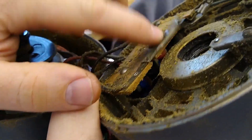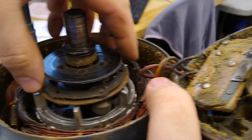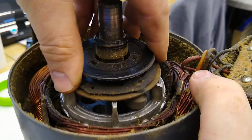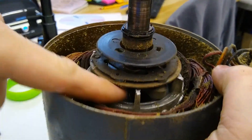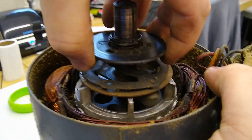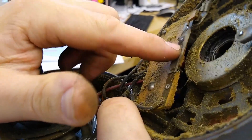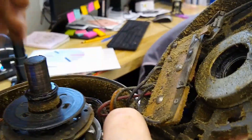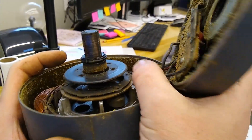So this motor does have a centrifugal switch here, so we're going to figure out exactly how this works. Right here, this is a centrifugal spring — it has these weights. You can't quite see them down here; we'll take them out in a little bit. But as this motor spins up faster, it shoves this piece right here further up, which presses this switch and should kick out a starting winding. But I thought these always had to have a capacitor, so we'll take it apart and see what else we see.